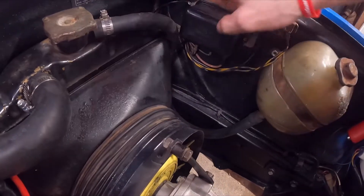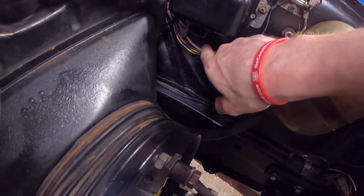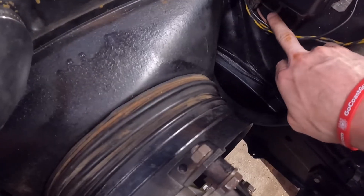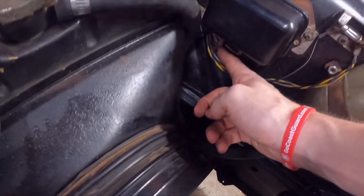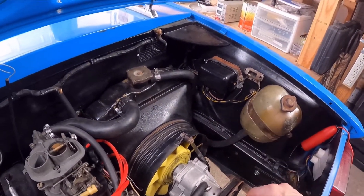So we've got our voltage regulator back in. I did a quick shot of paint on that to make it look a little more fresh. Here on the end you see where it says B-plus — we've got our pink wire, which goes directly to our starter solenoid, or starter post. Then in the middle we've got our white field relay wire, which is the small one on top of the generator. And then we've also got the brown wire here at the end. So that is installed, and since the battery is still disconnected, let's get underneath that dash and put in that indicator relay.